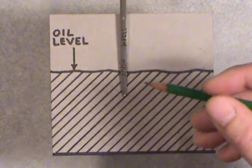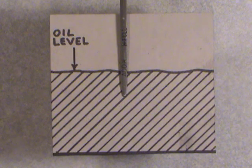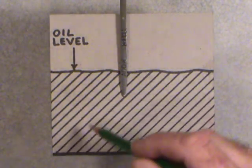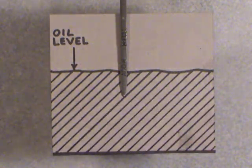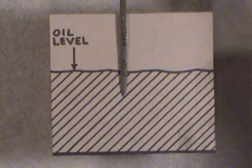Like I say, you might hear some hydraulic lifter going click, click, or clatter, clatter. That's lack of oil around the pickup screen, where it picks up the oil. The oil pump might be drawing in air with that oil if it gets too low. Generally it doesn't, but it can go the other way too.